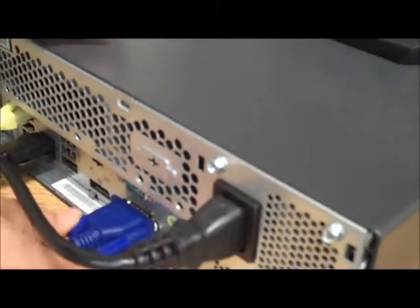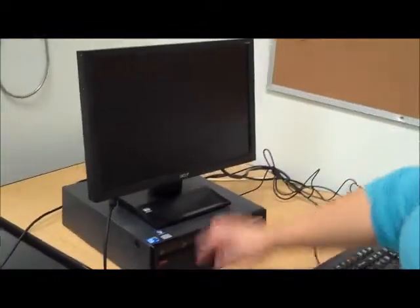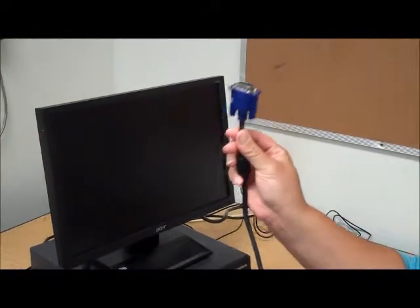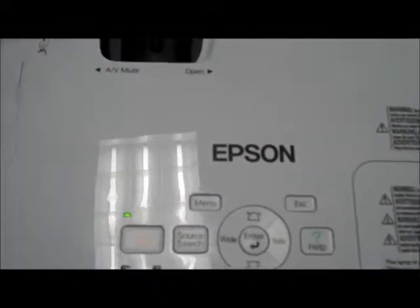All the images will appear from the CPU to the projector. Once all the cables have been connected, turn on the projector, and then come to the computer and turn on the computer. There will be no image presented on the monitor because we have detached the RGB cable that led from the monitor to the CPU. The only image will appear on the screen. If your LCD projector has an open and closed cabinet, open it up so that the image will appear on the screen.